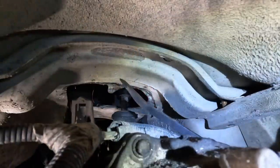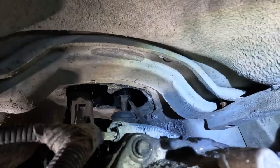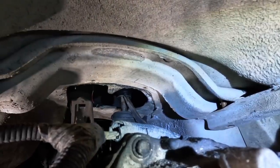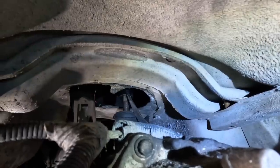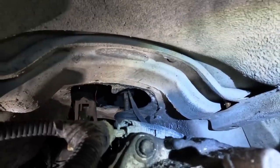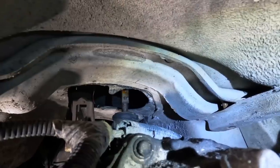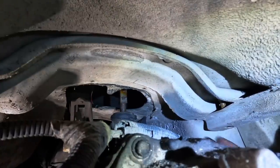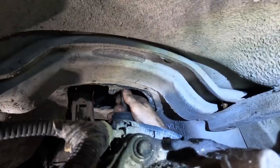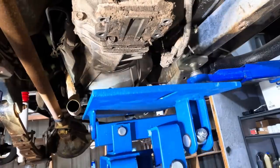I went up into the cabin and got rid of all the bellows boots and everything around the shifters. So now I'm just going to hit them with a hammer to knock the shifter off so I can remove it. There it goes. Make sure that goes back in its home. Now I can lower this thing down, unbolt it from the engine, and we'll get it out of here. The trans jack is going back into place to take the weight, and then I'm going to secure it to the jack with a strap or two.